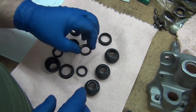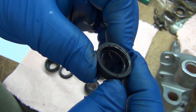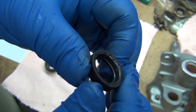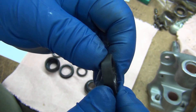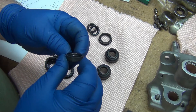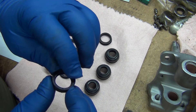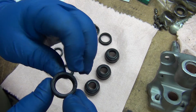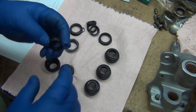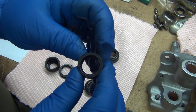Little nick right there — this one has quite a bit. That's my bad for pulling them out with the screwdriver the way I did. This is the first one; I was more gentle with the other ones because I had a better idea of how they came out. This one here, there's no damage. There's a little scar in the rubber there — that could have been from before, but that's probably where I pried it out. It didn't break through to the metal, and for the way this sits in, it's not an issue anyway — it's still going to seal the grease just fine.